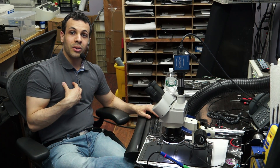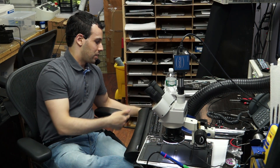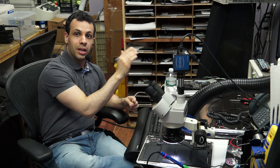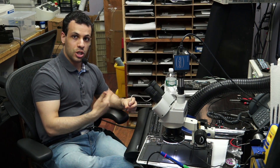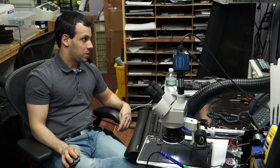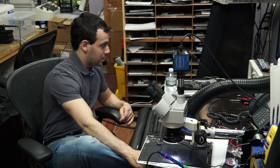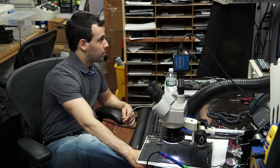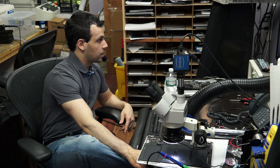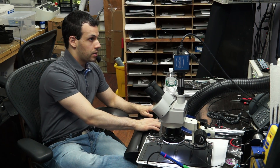I know that I need 3.42 volts for the one-wire circuit, I need the one-wire circuit to turn on the charger, and without the one-wire circuit working, this chip is never ever going to do its job. I know the one-wire circuit communicates with the SMC, and the SMC communicates with this chip. In previous schematics this was made just a little bit simpler, so let me go to an older board and show you how I first figured out how this worked.